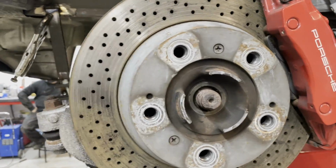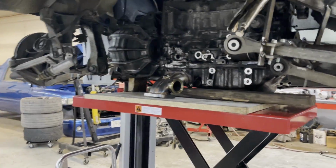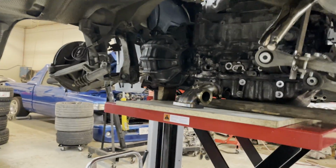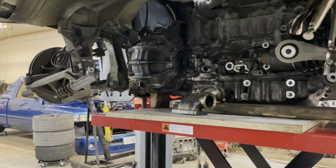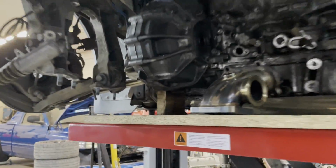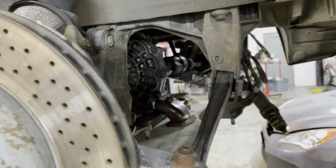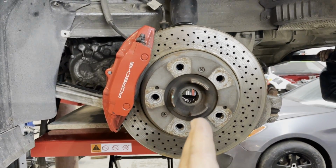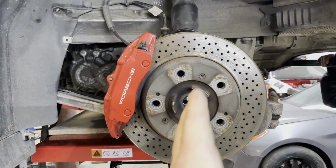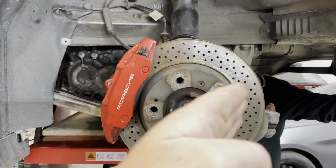And then to address the other concern that people had about the axle angle, and yes, that was one of my biggest concerns and why I had kind of ruled out this swap in this configuration entirely before we got around to test fitting it like we did. And the reason is the way Porsche had positioned the engine and transmission in the Cayman. The axle used to come through this space. And if you look at how that is positioned with the center line of the hub, it actually is angled backwards. And there was a significant angle for the OEM axles.